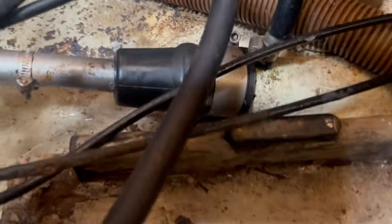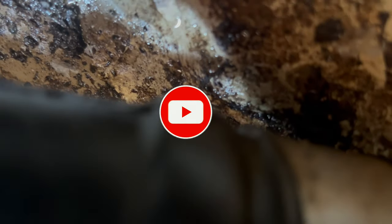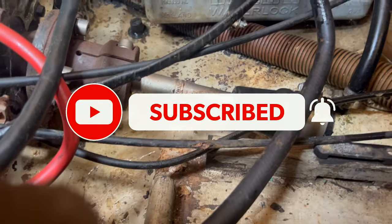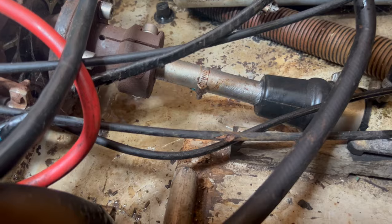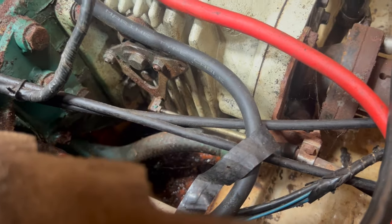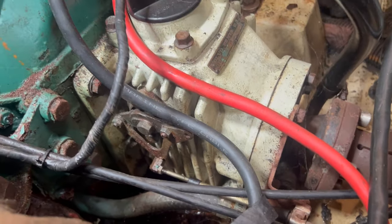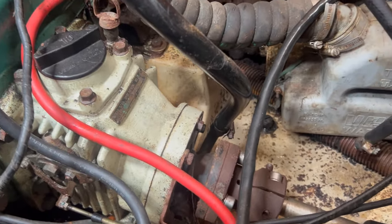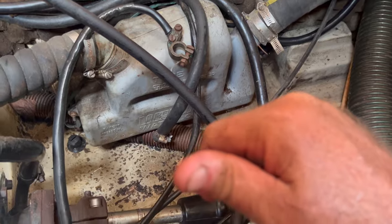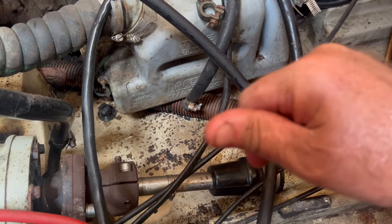And oops, another leak, look. Can you see this? This is the shaft seal. Drip, drip, drip. So we're getting quite a bit of water there, which is floating through underneath the engine. But at the moment it's not got to the main keel yet. But it will do. When it does, we can deal with it. So I'm going to keep an eye on that while I'm still here. Great stuff.